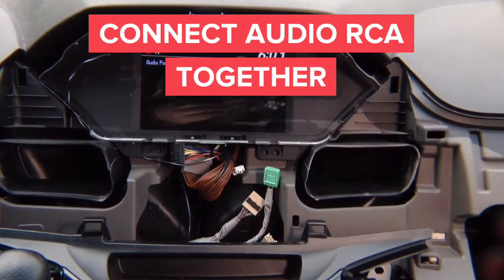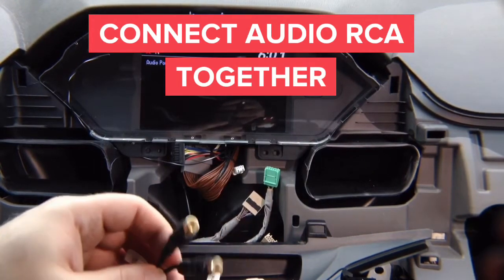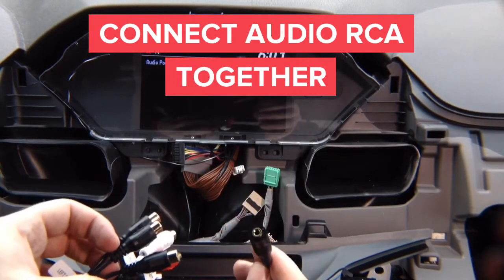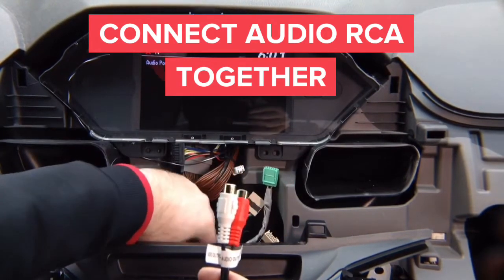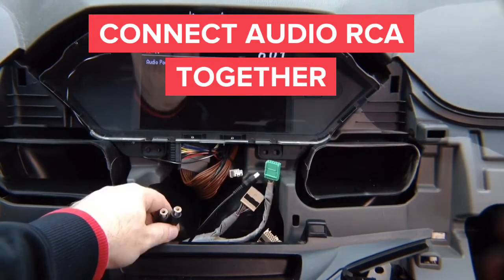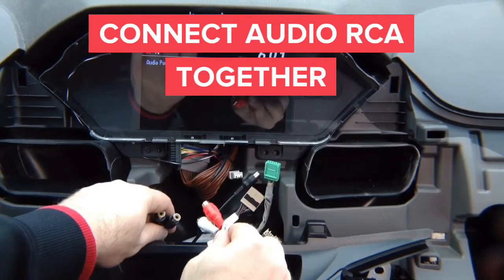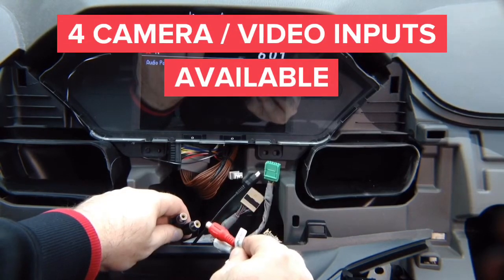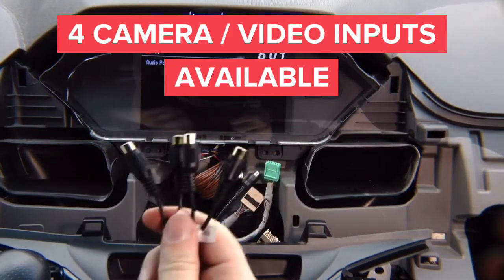If you're doing mirroring or CarPlay you don't have to use any of these wires — they're already insulated at the end. Do not use them with mirroring. You will need the white wire if you're not purchasing the optional remote, to activate the interface with a push button. Even with mirroring you can buy an optional remote. In CarPlay, none of these wires are used; in mirroring, just the white wire is used. You also have an input for the wireless remote control.